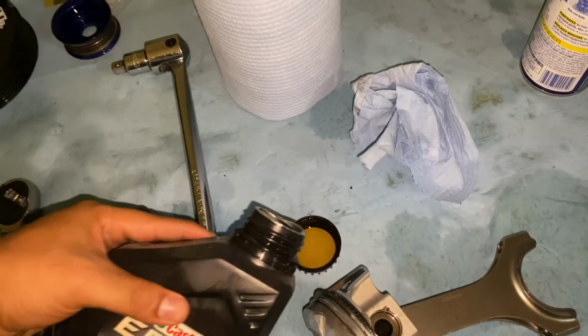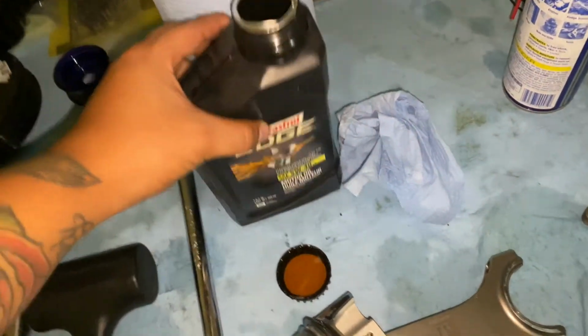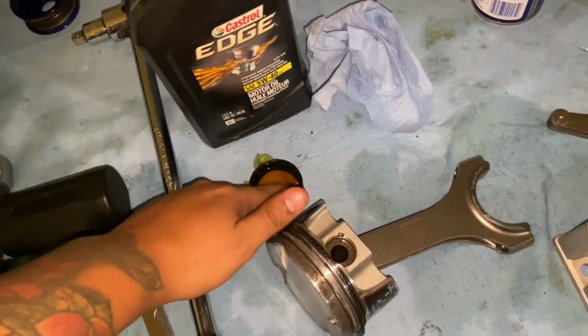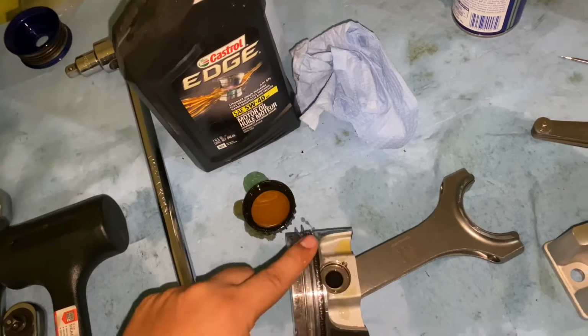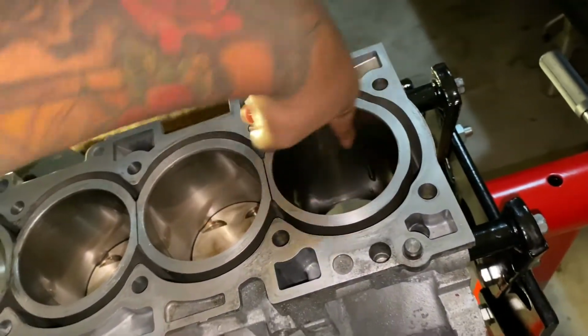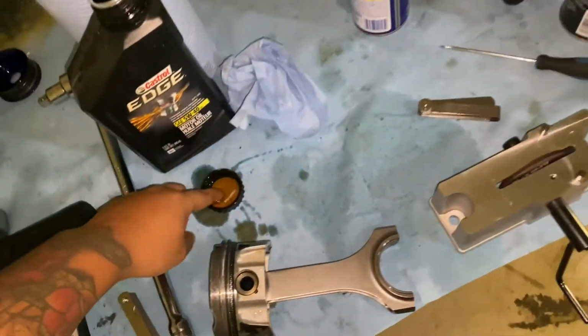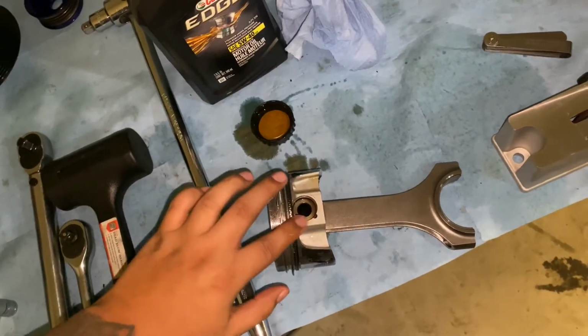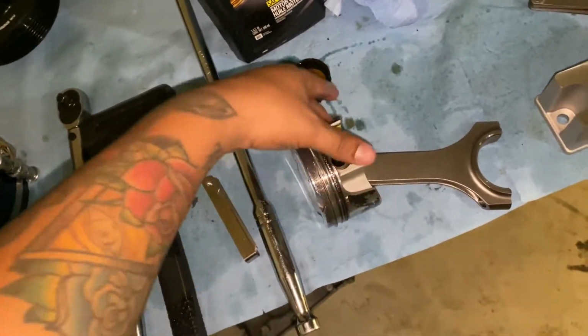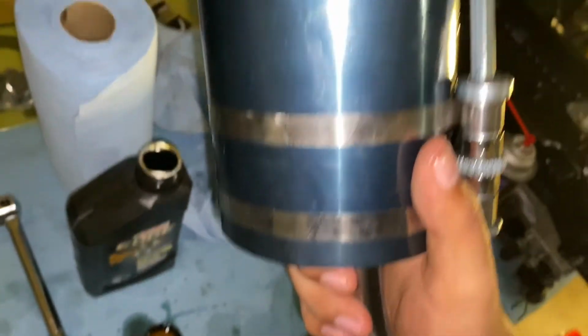Some more oil. And what we're gonna do is put oil all over the pistons, okay? Wherever the cylinder walls are gonna touch right now, we're gonna put oil all over it. So here, put some more oil in here. You want it nice and lubricated because you don't wanna go in and force in the piston with no lubrication, or else you might break a ring, or even worse, scratch the cylinder walls and then you're not gonna have a perfect seal. All you do with this is wrap it around the cylinder or the piston like that,